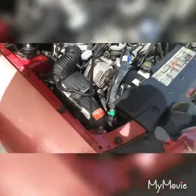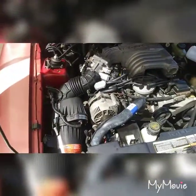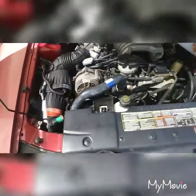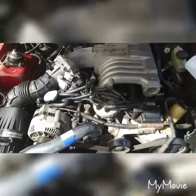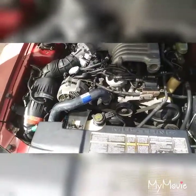Here it is running. I'm going to let it run for five to ten minutes, let it warm up fully, then turn it off and on again and make sure we don't have any leaks or vacuum leak issues from taking off the manifold. If there are problems it might be a fuel injector issue, but that's why we're letting it run.